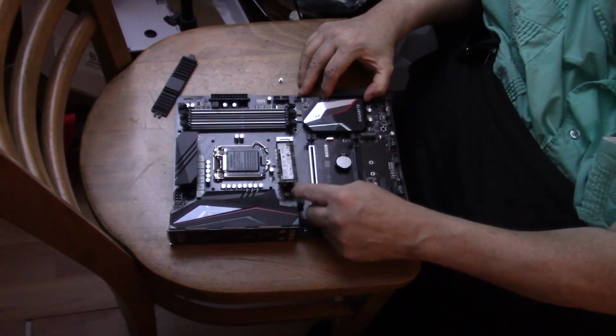The little slot, you see the little slot? That little slot matches the socket in the board. You don't want to flip it over, you don't want to force feed it. You just want to put it in there, and then it looks kind of like a diving board.